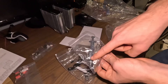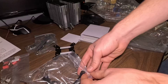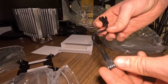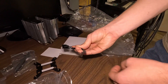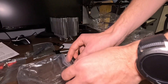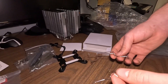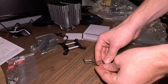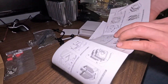There's thermal paste that it comes with, so you do not need thermal paste to install this cooler. It also comes with a splitter cable — you can plug both fans into here and only use one port on the motherboard, which is good because mine only has one CPU fan port. There also appear to be the fan mounts. I've never installed fans this way using these mounts, so it's a learning experience for me, but luckily they came with instructions.